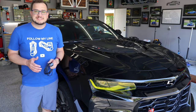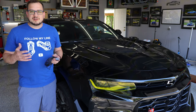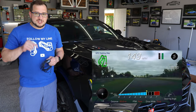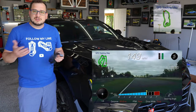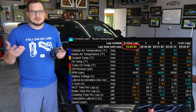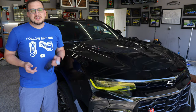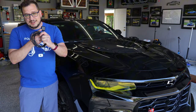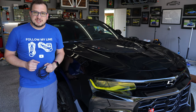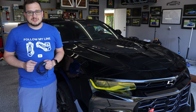Hi everyone, welcome back to the channel. Do you have a Camaro with PDR and some pretty irregular track map data? Has your on-track location gone haywire during one of your stints? Have you gone back through the data and seen that you've only done one lap when really you've done probably eight to ten? Today I'm going to show you how to take this GPS antenna and use it instead of the vehicle's factory GPS antenna to fix that crazy PDR issue until GM releases their own fix.